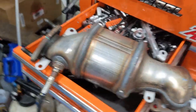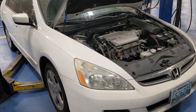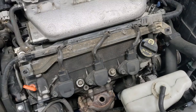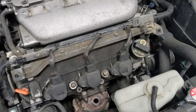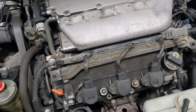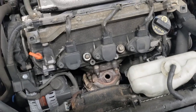I've got another little project going. This is the Bank 2 or Front Manifold Cat for my 06 Accord. This thing was throwing a P0430 a few months ago. I tried replacing the downstream oxygen sensor to see if that would fix it, but it's in a bit of a tight spot down here. You really can't get to it without removing this whole thing, and that wasn't happening. So I messed it up, and now I get to replace the whole thing.